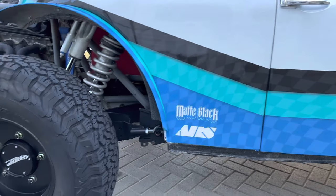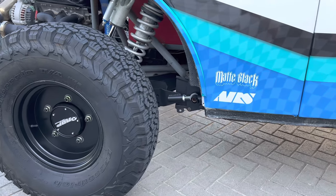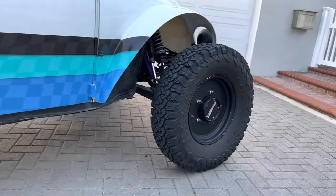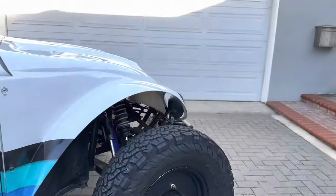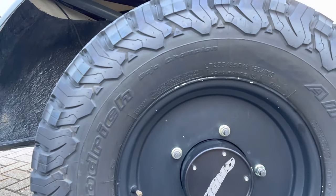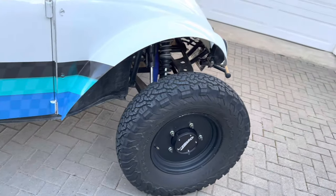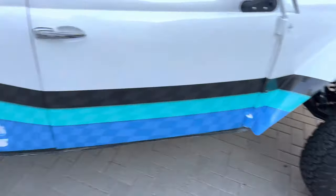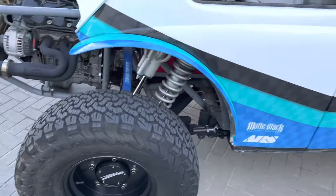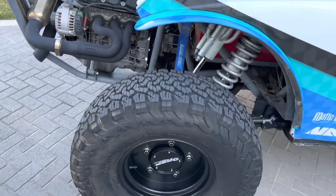American Rim Supply in Carlsbad are the wheels. I think the front is 16 by 4, if I remember correctly, to get some tall skinnies. They're 235/85/16 — like dually rear tires — but I wanted something tall and skinny that were BFGs.